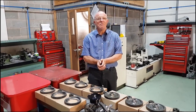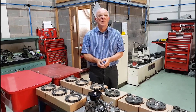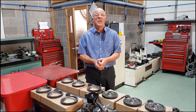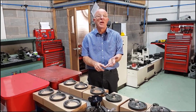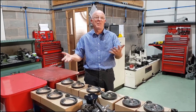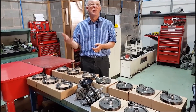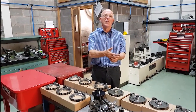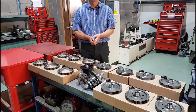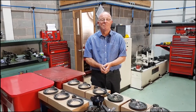It's always a compromise between a competition car and a road car. If you get stuck with any of this, give us a call and we'll talk you through it. It might also be good to speak to your fellow competitors and see what everyone else uses with a particular cam. As a quick example: Mini Miglia on 10-inch wheels runs 3.93, whereas most Mini Sevens on 10-inch wheels run 4.5 or 4.7. That variation depends on where the power band is and the power of the engine. Have a browse over to med-engineering.co.uk for all the final drives, and if you've got any questions let us know.